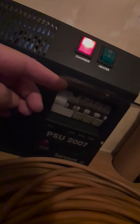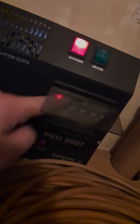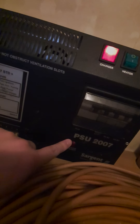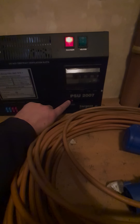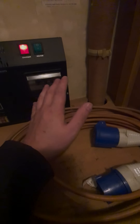That's the circuit breaker for the mains, like a domestic circuit breaker at home. If they're tripped out in the down position, everything goes off, so they need to be in the up position. There's a test button - if you press that, it should test the whole system. That light there, if it illuminates, indicates reverse polarity. That doesn't really happen in this country, but if you go abroad the positive can be on the negative side. Some appliances such as mains televisions won't like that supply, so you can get a reverse polarity cable which fits onto this - I'll show you outside - and that reverses the polarity back around.